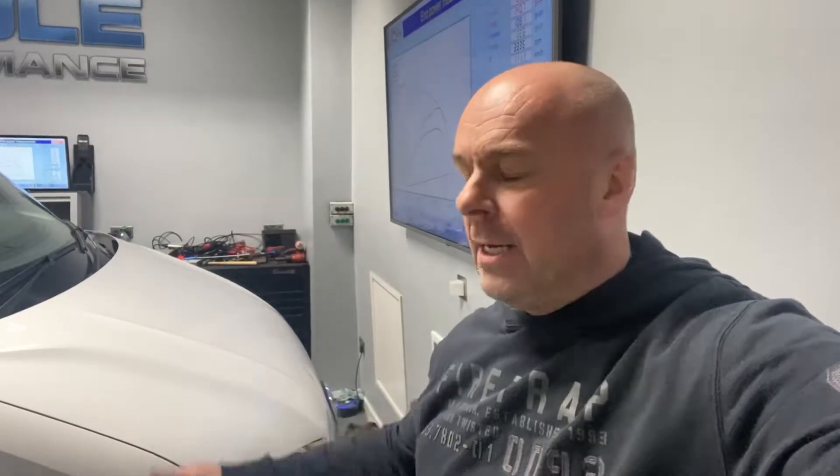Good news is, the 140 brake horsepower is a software-restricted engine, meaning with our tuning we can get really good power increases with a really safe engine — we've got really safe EGTs, we're running correct lambda, we've got correct boost pressure, we've got correct fuelling, etc.